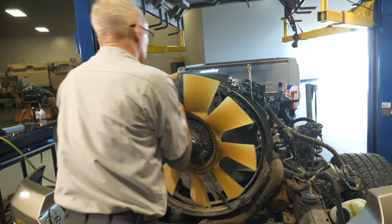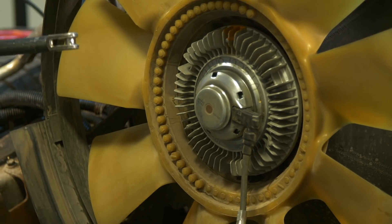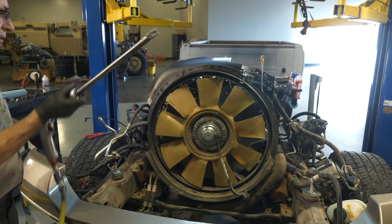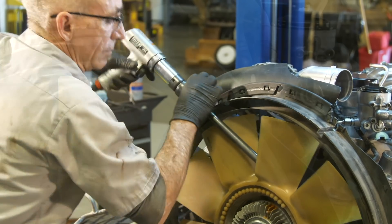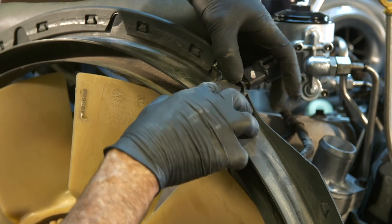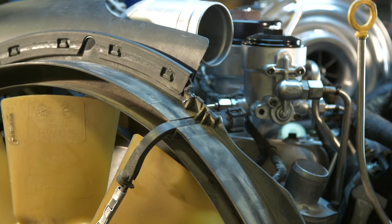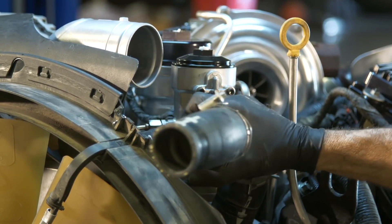A 6.0 is a clockwise rotation, unlike a 6.4. Some people just spin them on and call it good, but if that fan comes off while the truck is running or after you shut it off, it's a radiator and possibly more. So I like to give it a good cinch. Just one self-tapping screw and that'll keep that from moving at all. You'll notice they have arrows — the arrows will always line up with the little indentation so you can locate them right. All the Ford factory hoses have it.